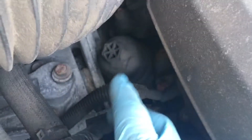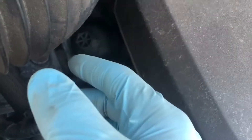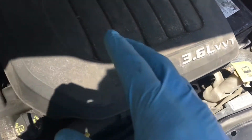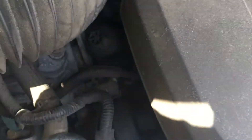The next step is the oil filter — it's right here. This is a cartridge style filter on this vehicle; sometimes cars have a canister style. The way you figure out what filter you need, you go into the parts supply store. You're gonna have to tell them you've got a 2014 Dodge Caravan, for example — that's what this is — for the 3.6 liter V6. Tell them exactly what you've got and they'll give you the right filter for your application.